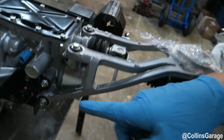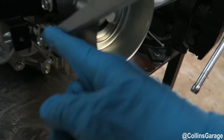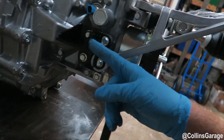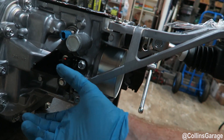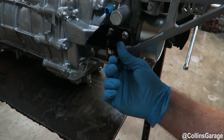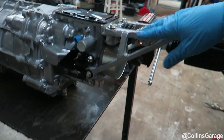12mm, 12mm, 12mm right there, 12mm. The trickiest part about this piece is we found that you can't get this one off without taking off this anti-vibration bracket that holds a weight — typically a weight about this big to prevent vibration or oscillation. The easiest way if you don't want to take that off right away is to bend it up with a pair of pliers to get your socket in there to remove the whole tripod.